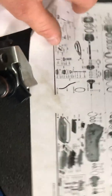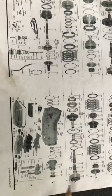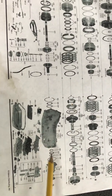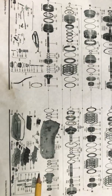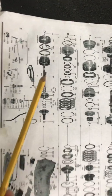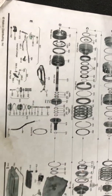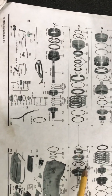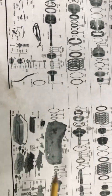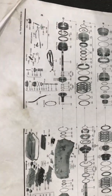What I found is that I got an exchange on the rear section of the transmission. You have a speed sensor at the front location and one at the rear location, and then there's an adapter plate and the transfer case that bolts on there. Part number 845 is a reluctor ring, and not every transmission has that apparently. The one I got back from my rebuilder doesn't have it, and that's what this rear speed sensor needs to operate.